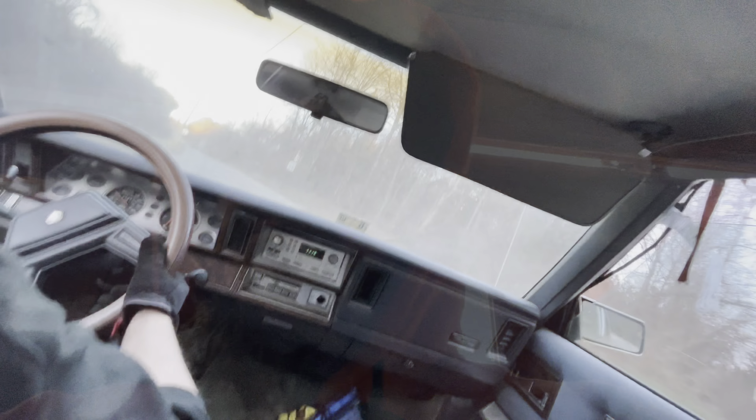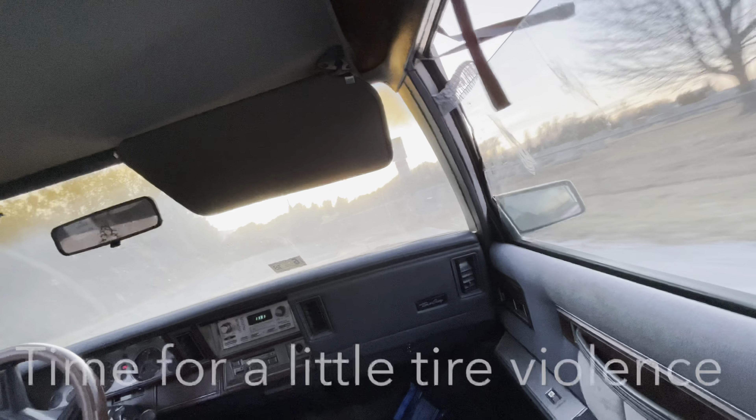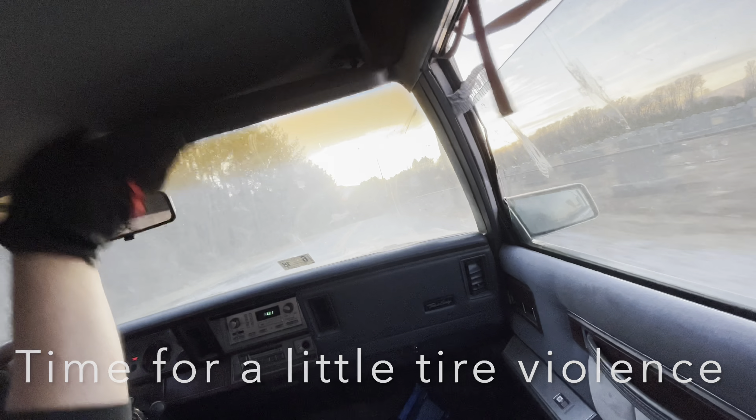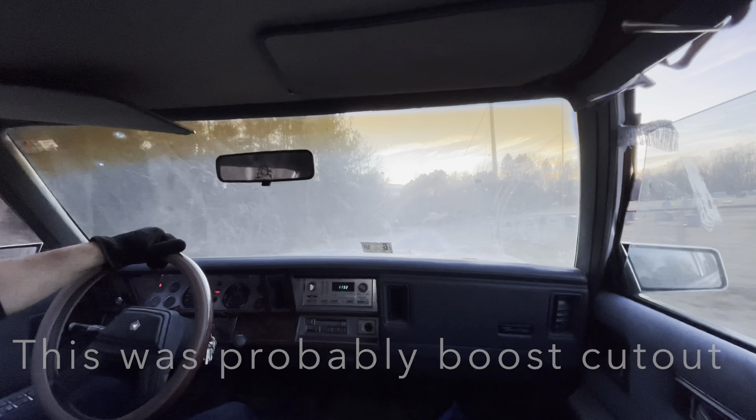A couple zip ties and I'm going to be good to go. One wire is a triggered key-on wire, one is a wire that goes to the field on the alternator, and one is a direct feed from the battery that runs over to this relay. I'm going to mount this relay right on there and call it good. I might loom it up and tape it to make it look pretty, but I wanted to do this so I'd never have to do it again.